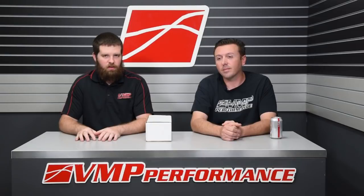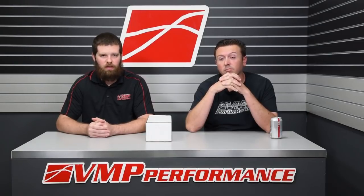But cold air is definitely a good step 1. Tune's definitely a good step 2, or even a step 1 and step 2. And then, the truck's already flex fuel from the factory, so if you want to run E85, just throw some in it. If you have our tune with E85, it just amplifies the power gains that you're going to get out of the tune. With the tune, we can do a lot of stuff with shift schedules, so if you tow a lot with the truck, we can cater something towards that. If you race a lot with the truck, we can do other stuff for that.